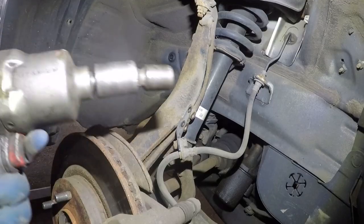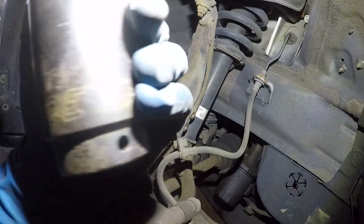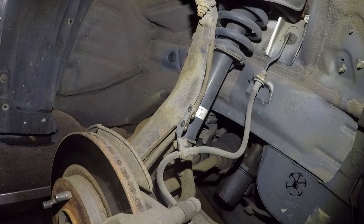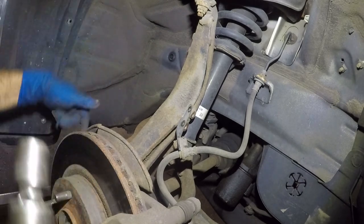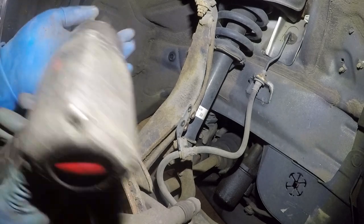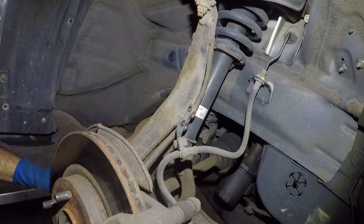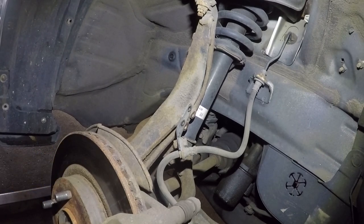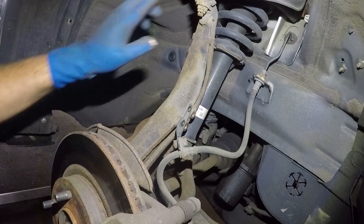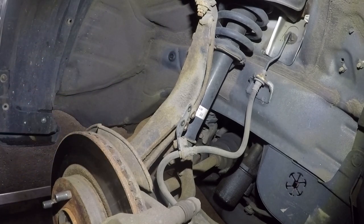All right, so one mistake I made, I told you guys 32, but I use a 36, all right? This is a 36. That's for the axle bolt right down here, all right? But down there, if you don't have a cotter pin on the tie rod, which I am gonna put, but it's a number 17 millimeter, so I'm gonna remove that. The reason why I wanna take that off first is because I am gonna bang it just like I'm gonna bang this. I'm gonna bang the tie rod area right here, all right? So let me go get my hammer.